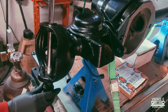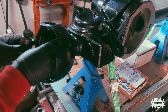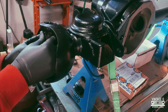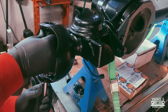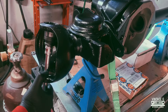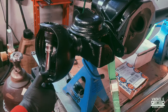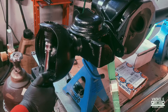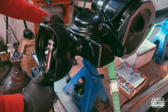Popping the bearing races on the pivot ball is as easy as taking a socket and a hammer to them. The first time I attempted to remove them on the truck I couldn't get very good access, mostly because I didn't know what I was doing, but with it up on my workbench it was a pretty easy go at it. During the powder coating process I was worried about powder coat getting into places it shouldn't, so I decided to leave the old races in the housing. That way the coating would go right up to the new race, protecting the area from corrosion. Unlike a Land Rover Defender, you can't replace the swivel balls without replacing the whole axle, so I'm going to see how they hold up with them coated as well.